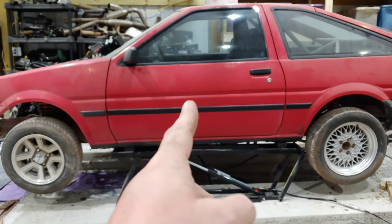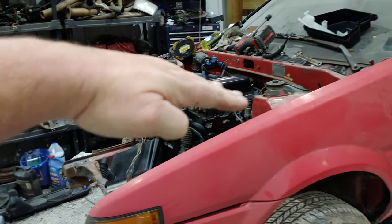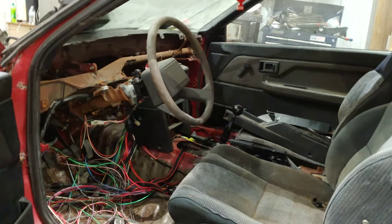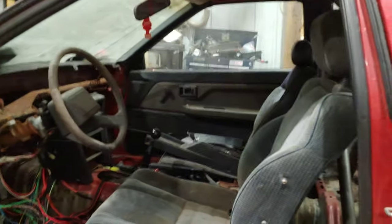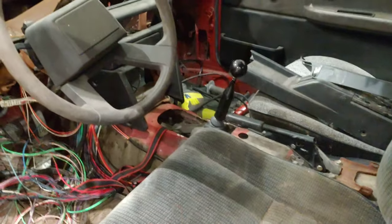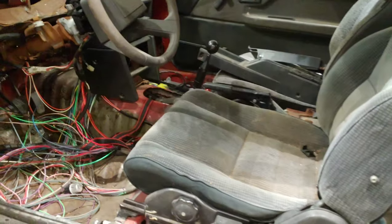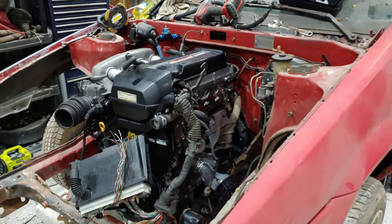Cut your tunnel to where the shifter will fit up in there. Something I recommend when you put your engine in: your transmission is going to weigh it down in the back. What I did — and it worked beautifully — is I took a big steel bar, like a six or seven foot steel bar, rolled the windows down, and literally stuck the bar through the windows. Then I took a ratchet strap, put it around the transmission and around the bar, and ratchet strapped it. It pulled the transmission up exactly where I needed it and I was able to go underneath and put the mount on no problem. It made the engine sit like it should.